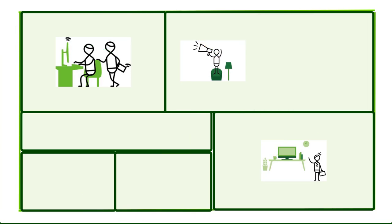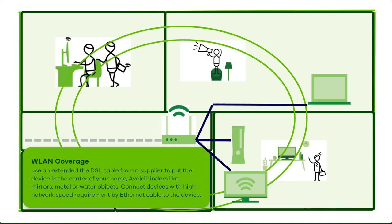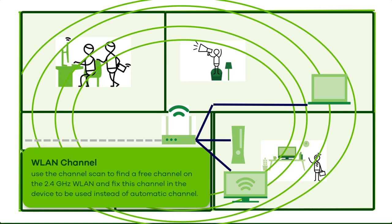Here is an example of a good device position. All wireless clients have a good connection with the wireless and a strong signal. Then all devices that use Ethernet cables can be connected directly to the device so that the Ethernet does not take over capacities of the wireless. Changing the wireless channel can also optimize your network. Make sure there are no objects from metal or glass that can distort the wireless waves and avoid clients from connecting to the network.